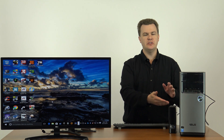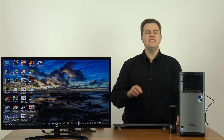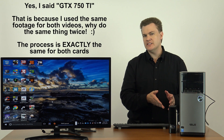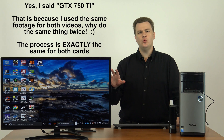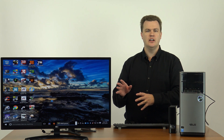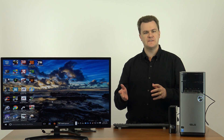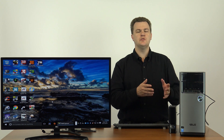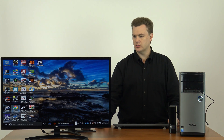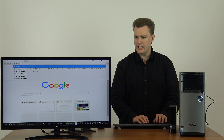Welcome back. Our computer is booted up and we are in Windows. If you look closely at the screen, you'll notice it doesn't quite look right, and that is because the proper display driver is not installed for this video card. We've just installed a nice Nvidia GTX 750 Ti card but Windows doesn't know how to talk to it. Windows will, given time and Windows Update, install a basic driver, but we didn't buy this nice video card to use a basic driver. So the first thing you want to do once you boot into Windows with your new video card installed is go to your favorite web browser — in this case, I will open up Google Chrome — and we're simply going to type in NVIDIA drivers.